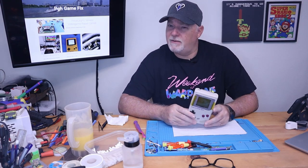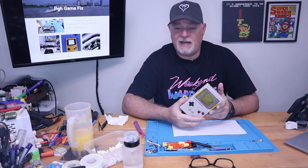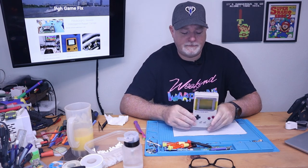That just about does it for this one. I know it was kind of quick and kind of simple, but for people just starting out working on their equipment, there is a logical path for troubleshooting. In this case, we had no power, so there's no reason to look at cartridges or anything else — we need to see if power is going from the batteries into the circuit board. We checked our batteries, we checked our contacts, we followed that up to the switch, and the switch is where we were starting to have problems. There have been other times where the switch checks good and then you get down into the power supply board and see there's no power coming out of it, and so on. I hope you enjoyed the video — if you have any comments or questions go ahead and make those down below, don't forget to give us a thumbs up and hit that subscribe button. Thanks for joining me and we'll catch you on the next video.